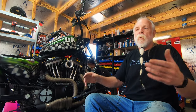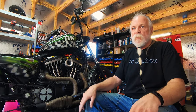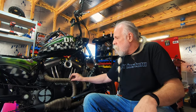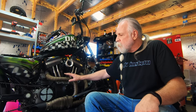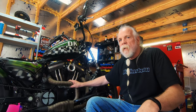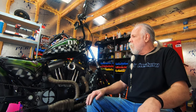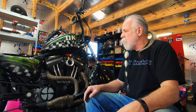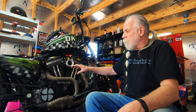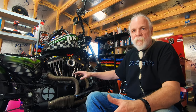And yes, that's going to begin rusting — just like water sitting on any piece of uncoated metal is going to rust. If I wash it, I'm usually going to ride it afterwards. If I ride in the rain, it won't be wet for more than a day or two before I ride again and dry it out. So just don't let it sit for days and days or weeks wet, giving that water a chance to start the corrosive effect. Any exhaust wrap is good if you're trying to reduce heat or get that little extra performance by keeping heat inside the pipe. We believe this is the best — there's a link where you can get it down below — and this is a little thing that makes a big difference in radiant heat.